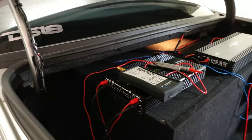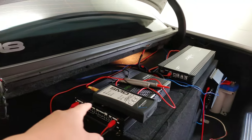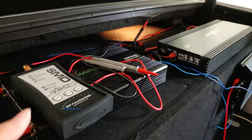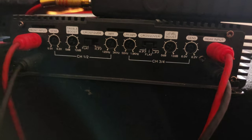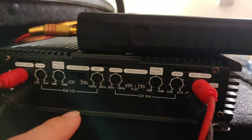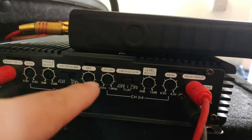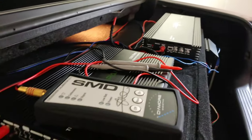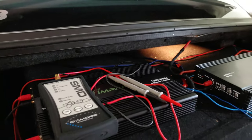What's up YouTube? I'm back with another video. After finding your maximum undistorted volume from your head unit and working your way back to your amps and setting your gains correctly with the DD1 Plus, you're now going to want to start using the CC1 from SMD so you can set your crossovers correctly. Many people try to do it by eye, but it goes from 120 to 3 kHz and you won't know what frequency you're at. With the SMD CC1 you're going to set it properly.